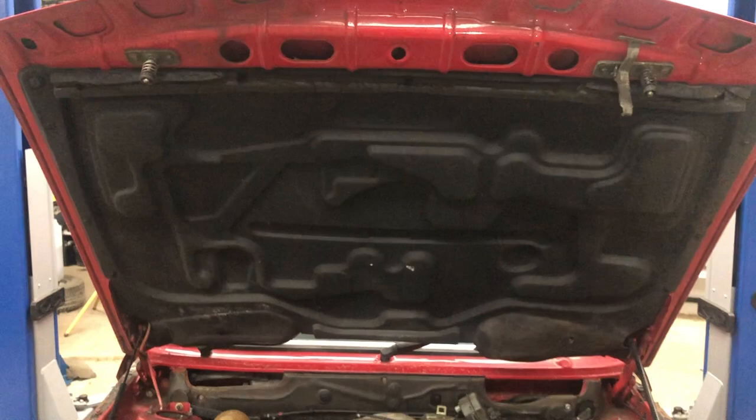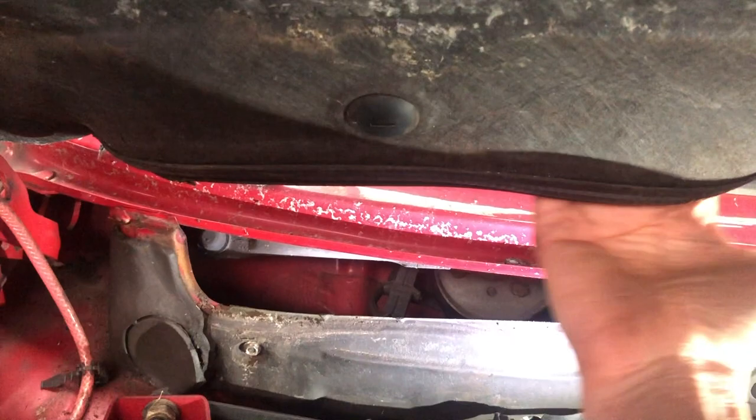Other places to look under the bonnet is the bonnet itself. This car being a late one has one of these later style bonnet covers and you can't see the skeletal structure — in my experience they're normally really clean under there. Have a good look along the front of the bonnet and at the scoops. On the back of the bonnet underside there are scoops — one on each side — and you literally just want to run your hand up inside the scoop and feel if it's rusty. They're made of fairly thin steel and they rust away.